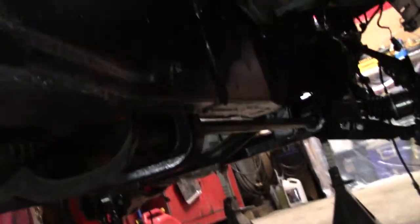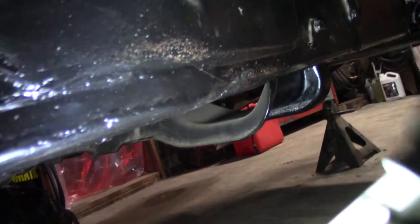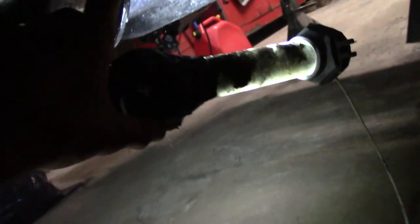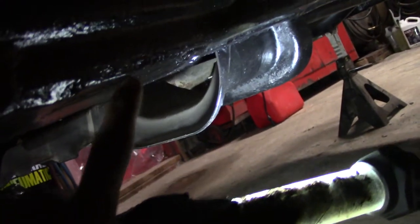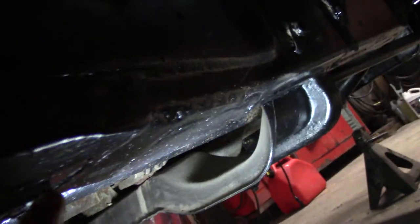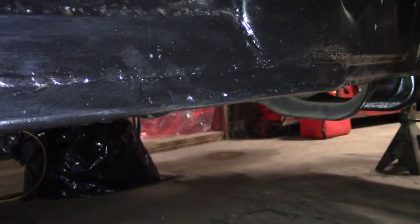If we keep looking around this corner — trying to run a light and point at the same time — we welded all the way to pretty much here. The bottom was rotted out, so we welded a flat piece in here that joins up here and runs up here, welded across. We did this on both sides — lots of fun. Chassis saver black, same thing done. But that kills these trucks, that's why they end up in the scrap yard.